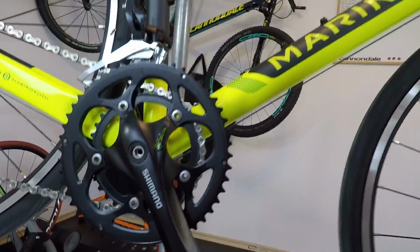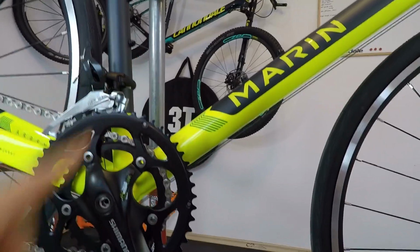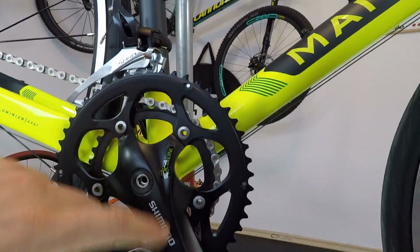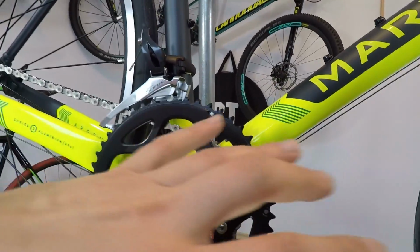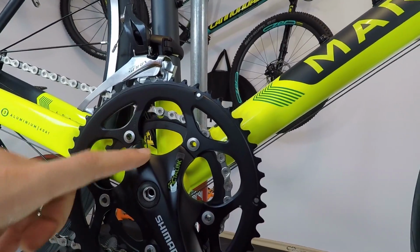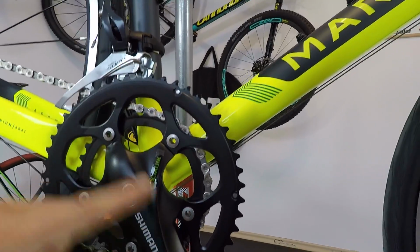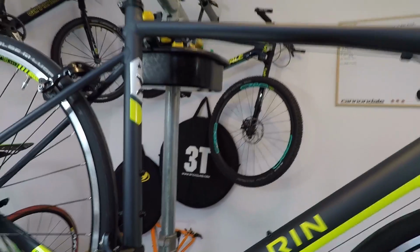This crankset, it's not a Sora R3000, because the Sora R3000 now got the two-piece crankset. So finally, the spindle, no Octalink like the older, really old design, isn't there anymore. On the Sora you will have the two-piece crankset, so the spindle will be one unit with the right crank arm, and it works so fine.